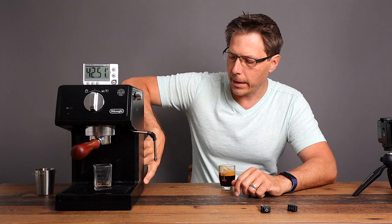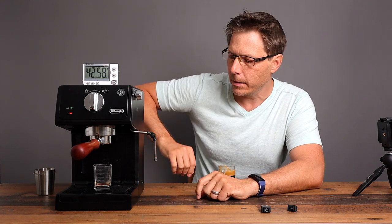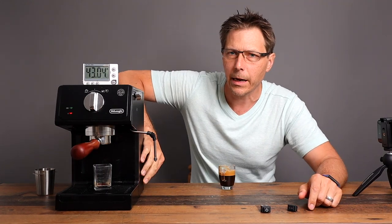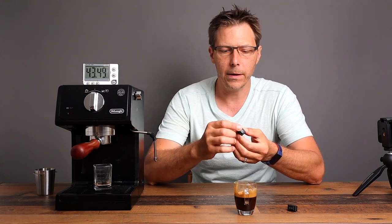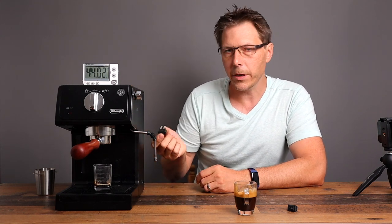However, if I turn it on and then want to turn it off within that first initial 10 minutes, the running timer actually doesn't turn off. So what you have to do is send in another impulse — on and off — and then it will turn off. The funny thing about the way this works is this switch on the side is not actually an on and off switch, but rather it sends a signal to the board inside. The board also has a timer on it. Originally with this instantaneous switch, you're just sending a signal for an instant — you turn on the machine, then it runs a timer for 10 minutes, and then because there will be no voltage at the switch, it turns off.